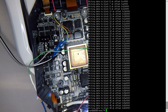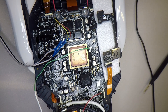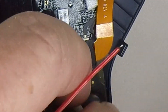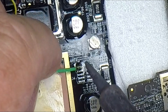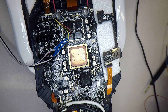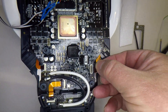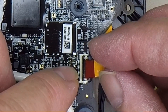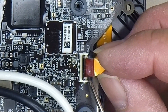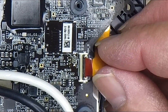Let's pop the battery, disconnect the wires I've tagged in, disconnect the other board, and get it to boot up. This board actually came from someone who sent me pretty much just the board. Be careful of those wires — make sure you don't do any damage to them. Alright, I can remove my probe wires. Plug in the original — you need to be careful with these, they really need to be sitting in properly. It's got a little piece on each end, little tabs on each side.